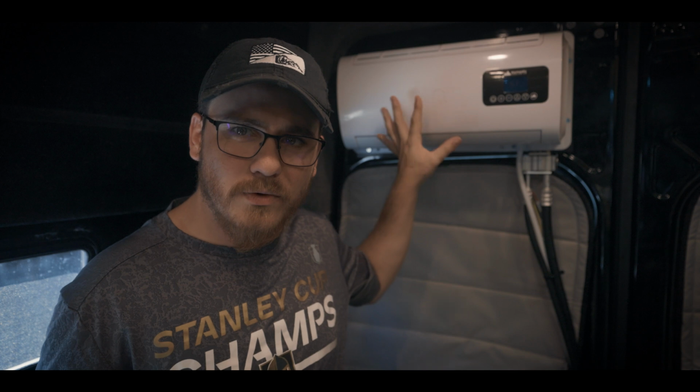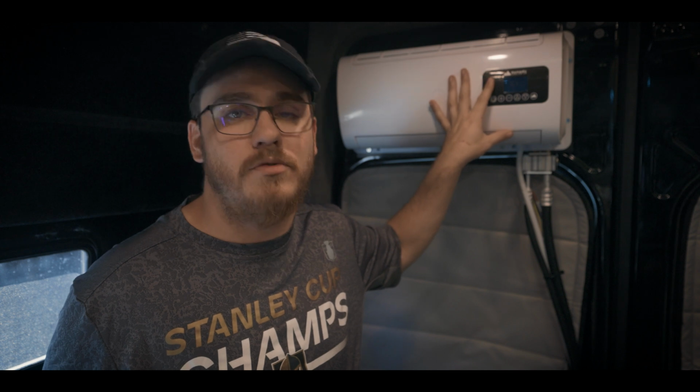Now let's talk about how I installed the inside unit and why I chose to do it the way I did. Now there's tons of different ways you can install this inside unit. So if you're looking for a mini split system for your van, it might be slightly different. I decided to put it on the same back door that the outside unit was on, and I decided to use the wood mounting slab that they give you, and the only reason is there isn't really any structural steel here that I could just bolt right into, but there are factory riv nut holes that I was able to put some riv nuts or plus nuts into to bolt the wood to, and then allowed me to screw this to the wood, and I felt like that gave me a really secure setup.